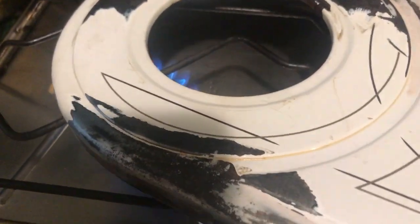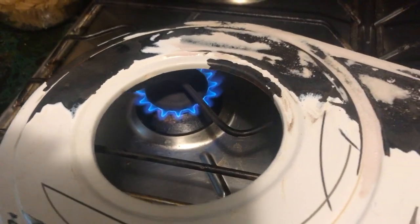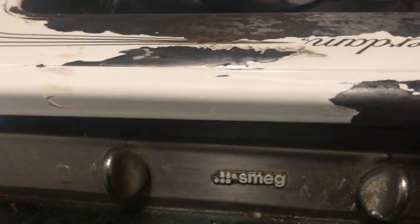What I'm doing now is just heating the metal up - not too much, don't overdo it. Warming the metal up and then leaving it to dry, because we need to dry out every little bit of moisture before we start putting the primer on.